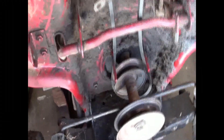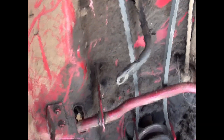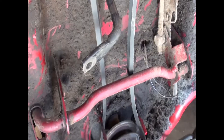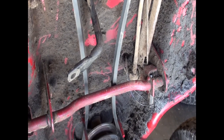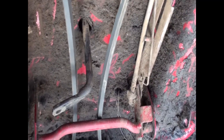I'll move it up and down again. Let's follow it all the way back — it goes up to here. The belt, as you follow it up, splits or straddles this mower engagement lever. When you pump the clutch pedal, you can see what happens. When you press the pedal all the way to the floor, that disengages the belt. When you release the clutch, that will cause this rod right here to move in that direction.